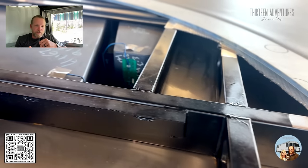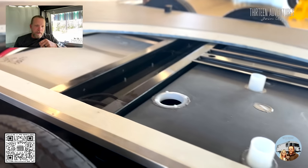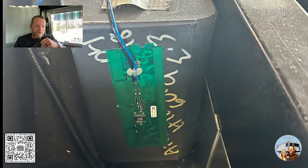The flooring is actually cut out so you can see the frames. Right there are your black and gray tanks. The white tanks there are your freshwater tanks, and then the hose going down underneath — that's a shot of your tank sensor. Sometimes they fall off, come unglued from the side of the tank, and they're no longer able to sense how much water is in it. If you notice, it's not quite to the top and not quite to the bottom, so your zero is not actually zero and your 100 is not actually 100.